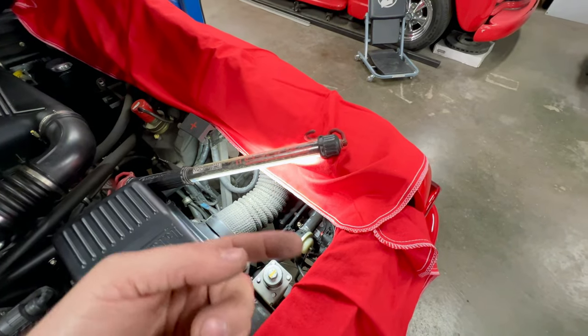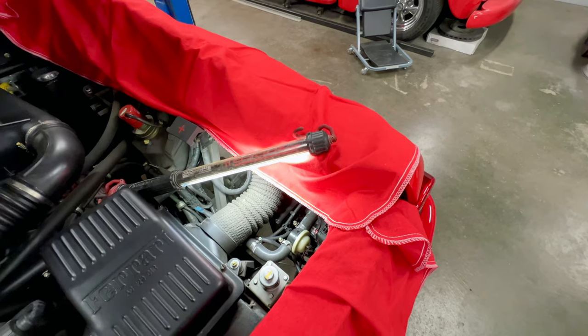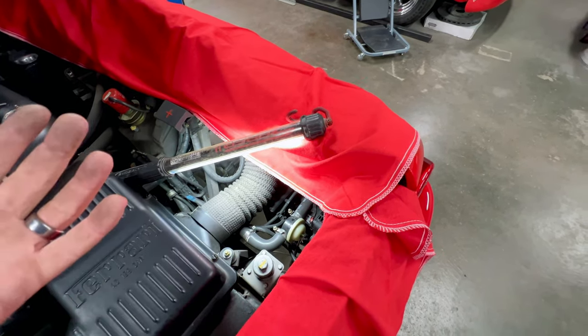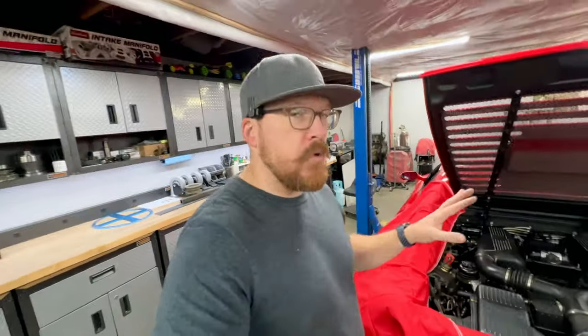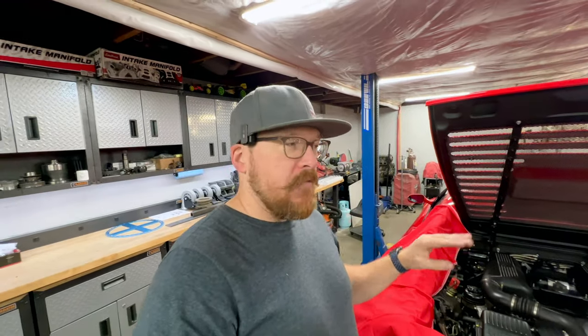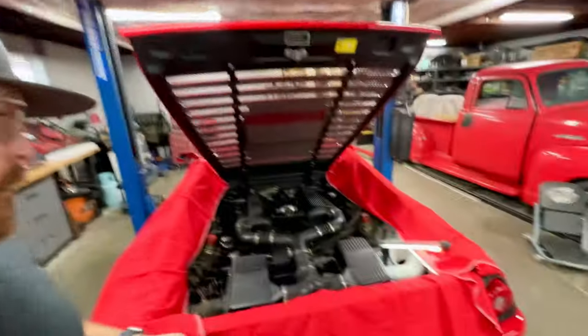Third, since I put the fuse in, I'm going to listen and see if the pump runs. If the pump runs, we're going to let the car run and see if the system operates as it should. If the pump doesn't run, we'll check the fuse, we'll check operation of the pump. So we can do a couple really quick, easy checks while I'm doing other checks on the car without really diagnosing the system, so to speak, and get an idea of how it's operating and if there's anything wrong with it. Relay that information back to the customer and see what he wants to do with it.